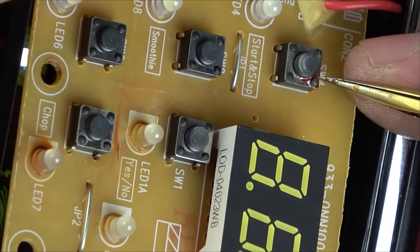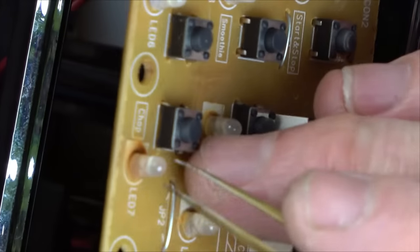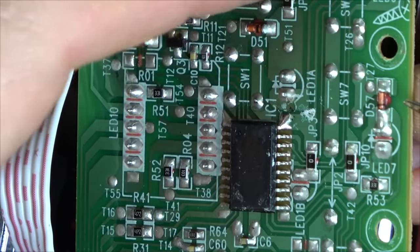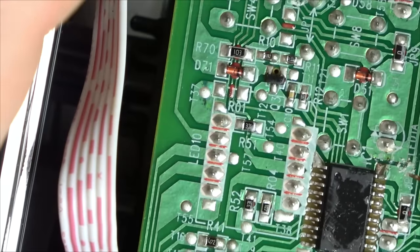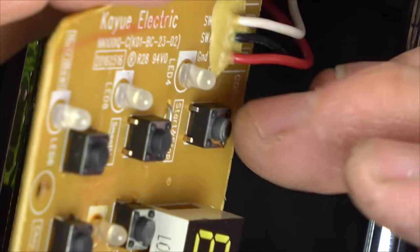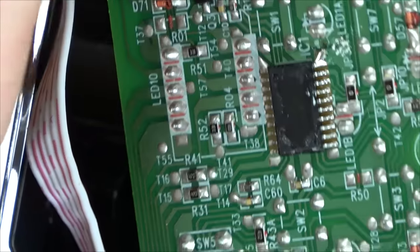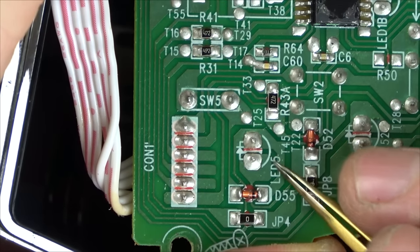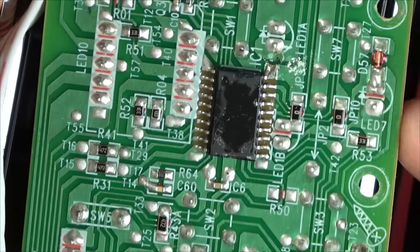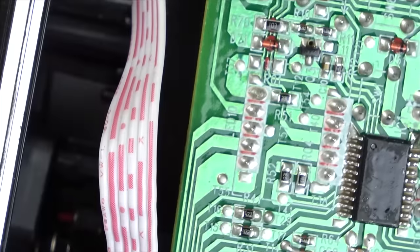So first of all, what's this up here? Yeah, that's some sort of liquid damage here. The switches do appear to be working. Have we got a diode next to each light? Yes, yes we have. Not that one though. Okay, so the LEDs are all labeled up here. Let's get a reading on the LEDs and see if we can light them up with the multimeter. We're going to go on to diode test - that normally puts enough voltage in to get an LED to light up.